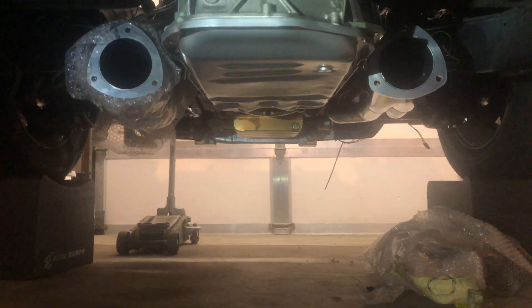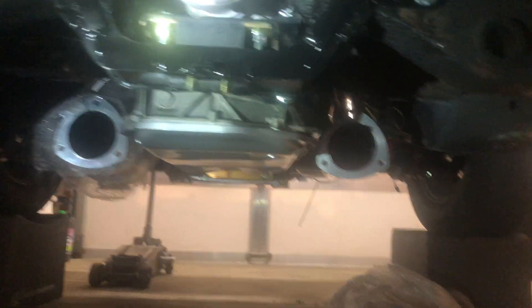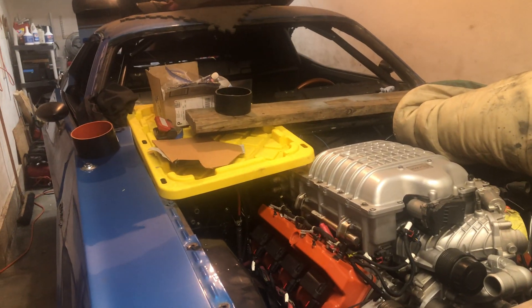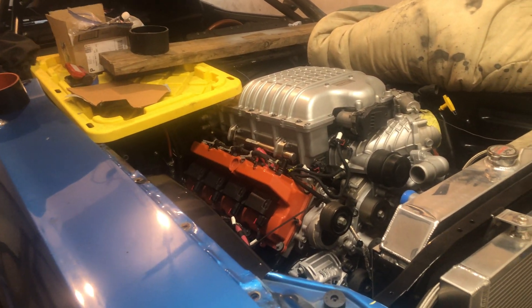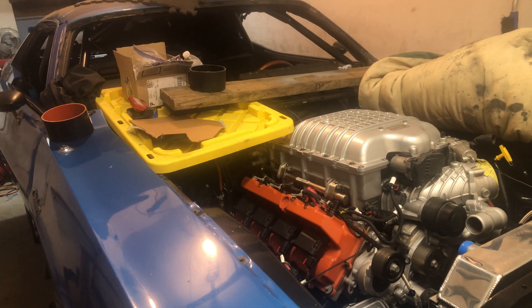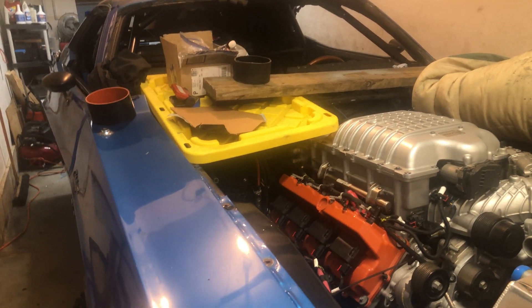The whole reason I'm focused on this is that I've been reading about a lot of issues with 8HP90 swap cars specifically - completely exploding the casing around the output shaft. Nobody seems sure what's causing it. Possible reasons include: damage from donor pullout cars that may have been wrecked, critical speed issues with the driveshaft, or the output shaft simply not tolerating any side load or up-and-down movement. Most guys who had the problem were using slip shafts.